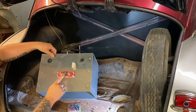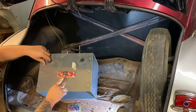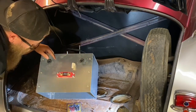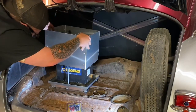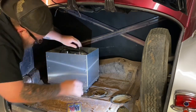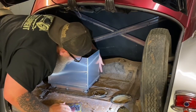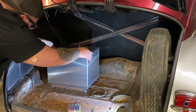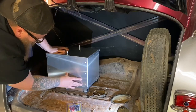Don't pass through anything without rubber grommets, and if your battery is in the trunk, put a mega fuse on it. You can get this off Amazon — look up automotive mega fuses. I think it might be a Petronix brand, but I always get the same exact fuse. Now let's put the lid on the box — you can see how this is going to be secure. You can wrap it in leather or carpet to make it look really good without spending a bunch of time bending aluminum.